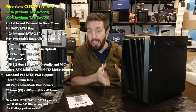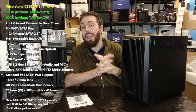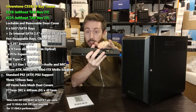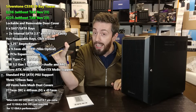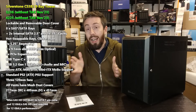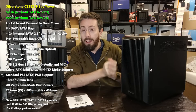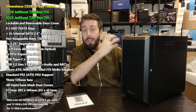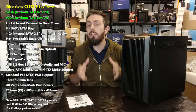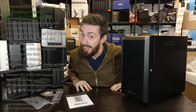In terms of active cooling, the system arrives with three fans: two directly attached to the newly improved storage cages and one rear-mounted fan. It supports up to 168mm height CPU coolers, so plenty of space inside. For PCIe card support, it supports full-length cards with up to five individual slot heights, so you can use big beefy cards. Thanks to ATX PSU support, you've got access to larger and more aggressively cooled PCIe cards. There's also USB Type-C on the front panel and improved cable management.